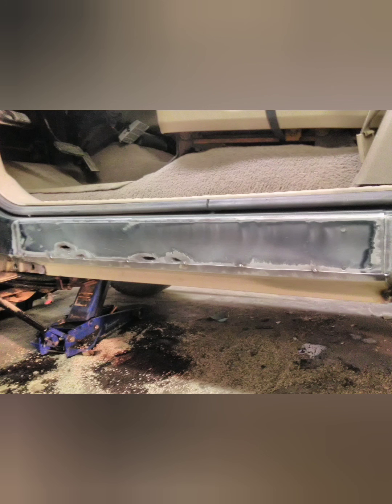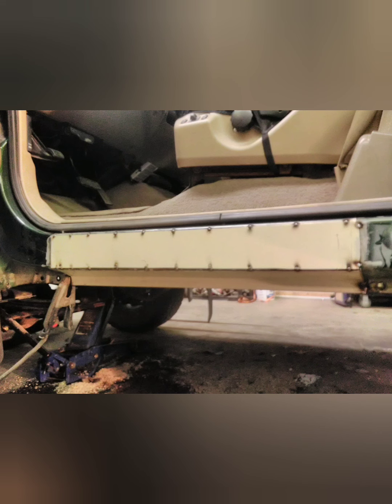Here is an example of how I ran into problems under the surface, quite literally. On both cab doors and corners, I discovered a gross amount of rusted out holes. I took an extra few days and patched the holes over with sheet metal and a MIG welder. It is advisable to remove battery cables when welding on your vehicle. I then applied Bondo to the creases and moved on.